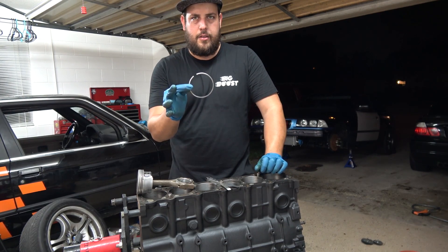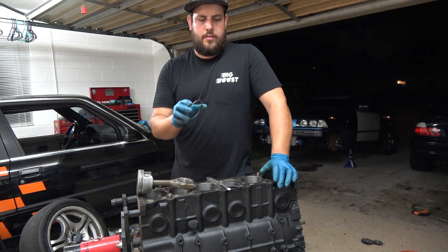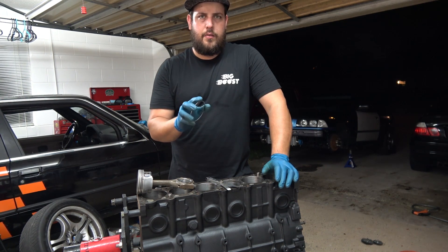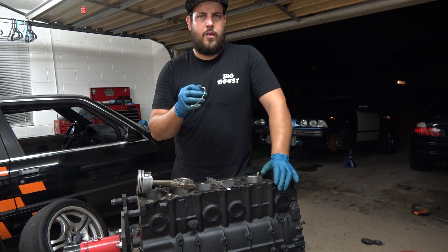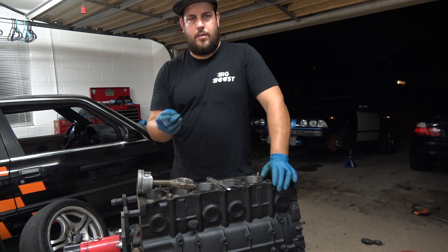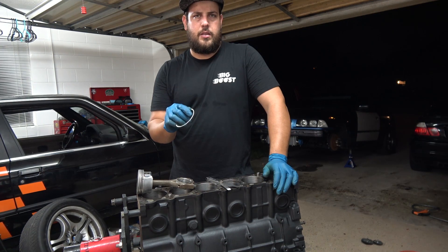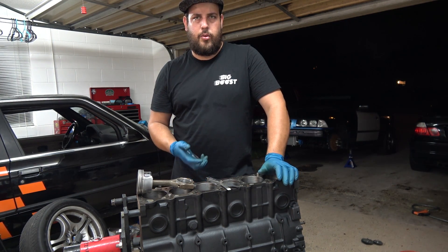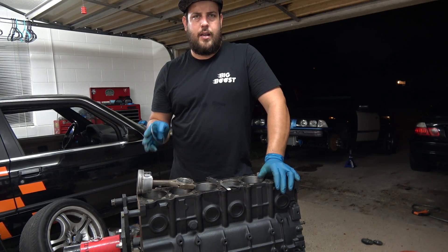You want to take out all the fine dust you can. This will also prep the surface better for rings and provide a better break-in period. The next step will be to file the rings to the proper gap. After doing some math and checking specifications, the factory gap spec for the 84mm on this engine will be 13 on the upper ring and 14 on the bottom ring. Since I'm going turbo, I'm going two steps up — so 15 on the first ring. And instead of 16, I want to relieve more pressure, so I'll go 17 on the secondary ring. My first ring will be two sizes bigger and my second ring three sizes bigger. That way I reduce the chance of the piston ring closing from heat and causing the piston to break. The second precaution is to run less timing to prevent detonation.